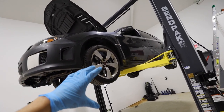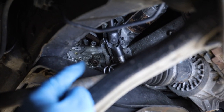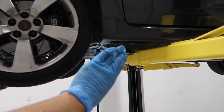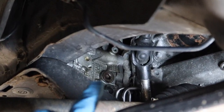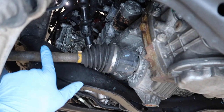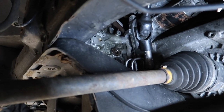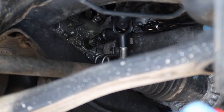It's a really tight space so it might be a little hard to see. To locate exactly where we're going to be plugging the cylinder four cooling mod in, you want to go on the left side and try to come from behind the wheel. It's a lot easier to see from back there. That little plug right over there — it's a 12 millimeter hex. That is what we have to take out, and that is what we're going to be plugging the cylinder four cooling mod into. You go from behind the axle and then around the steering shaft. Getting to that is going to be a little difficult, so I'm putting a bunch of extensions and coming in with a breaker bar.